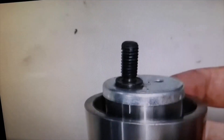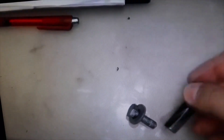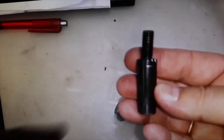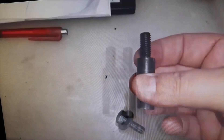The person who did the distribution made a mistake. Here we are putting the other screw — the one in good condition, which took us a long time to get, by the way. The problem is that when removing the bolt from the pulley, this screw can separate from the block — it is enough to separate a couple of millimeters for the separator screw to bend.